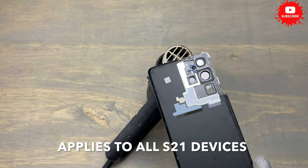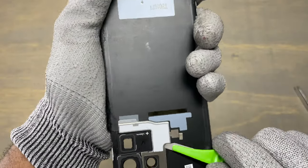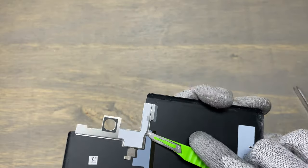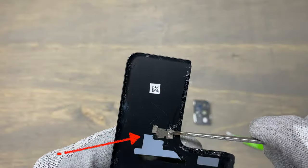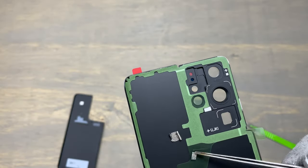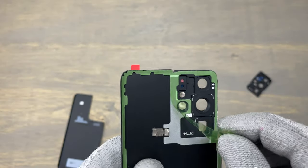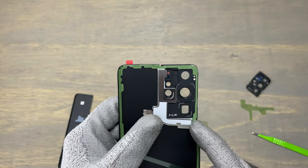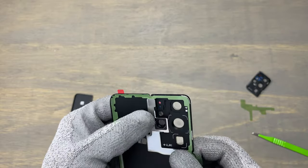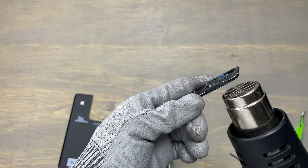The second method of changing the back cover on the S21 Ultra is to remove the components on the back of the camera bezel and transfer them onto your new back cover. Use a sharp metal tool to remove or loosen the camera bump on the back cover, then remove the metal piece that attaches the plastic and aluminum pieces. Proceed to remove the aluminum sheets near the camera bump and install all those aluminum pieces on the new back cover — this piece is likely for grounding. This design is especially why I think this device is not ideal for use in water.